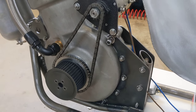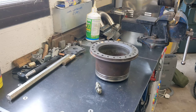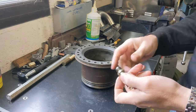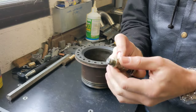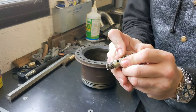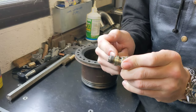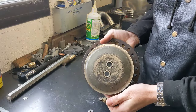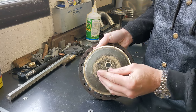That could be a big problem but we did think of this earlier, so it's not. Here we are on the bench. I have an old cylinder head from another engine and the head is in the vice behind me. This is a decompressor off a Royal Enfield Bullet 500 — it's a very simple thing. It's like a little poppet valve operated by cable, and you can just press that down with your finger and it will open the poppet valve that vents out to the atmosphere. It screws into a standard spark plug threaded hole in the top of the cylinder head. Now as luck would have it, since this is an aircraft engine there are two spark plugs because it would be magneto driven with two separate ignition systems, and this decompressor does actually fit into a Bristol Hercules head.